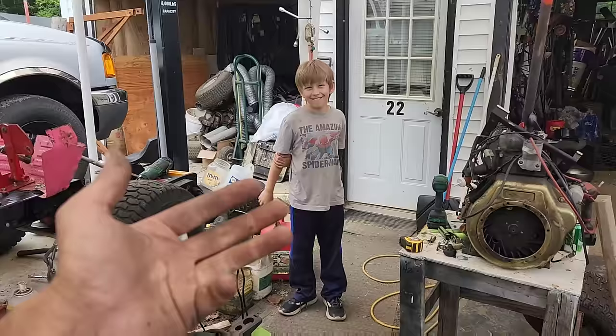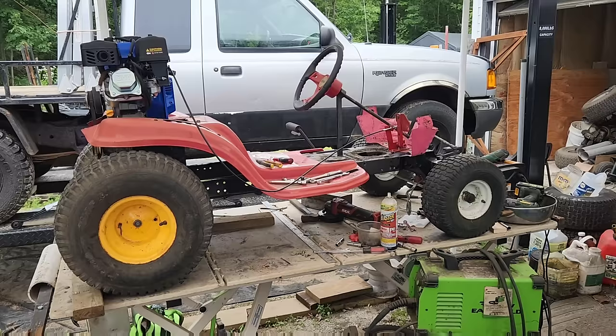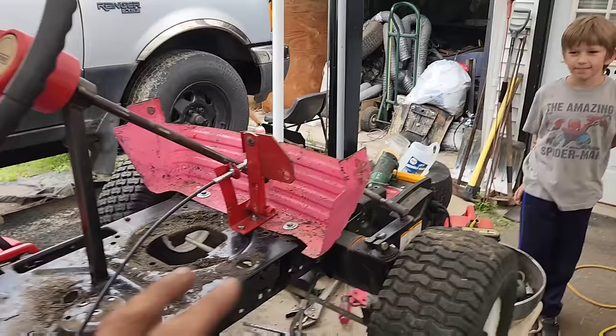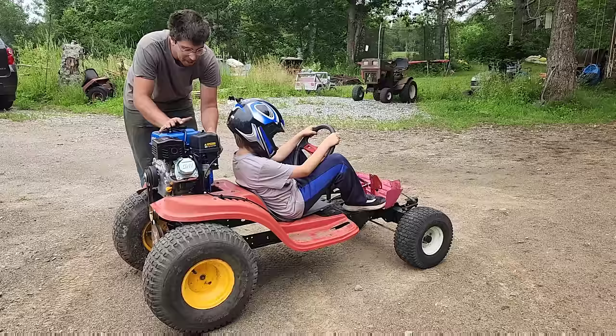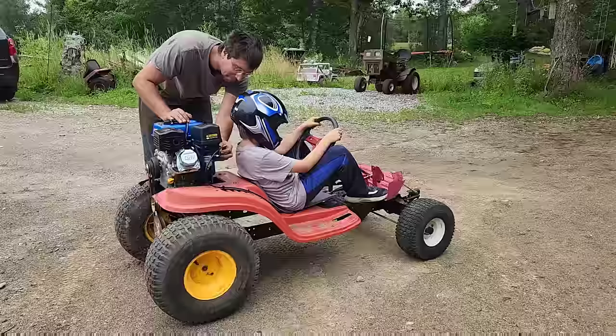Let's get rolled off of here. Is it me or does it have like dune buggy vibes? And yes, I know this is pretty in pink and it is ugly, but I wanted to have a foot catch of some sort on here just to get it out for a quick test run. Eventually we want headlights and hooking up the charging circuit and ignition and all of that stuff. We didn't get a chance to get the shifter mechanism fully done, but basically we just need to take the shifter that was on it, turn it 90 degrees, and run a rod up to the front - simple enough. We don't know which way is forward or reverse, so we're going to try it - we should be in neutral right now.